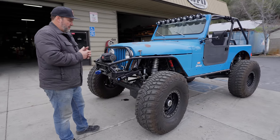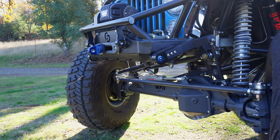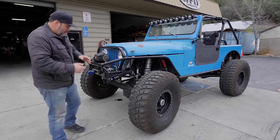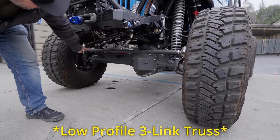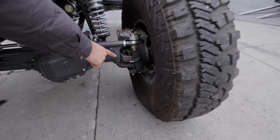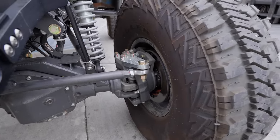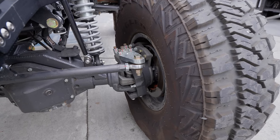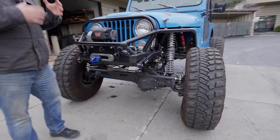It started with David saying, 'Build me a front and rear axle.' He gathered the engine, transmission, and transfer case and took all the parts to Clay. In the front we use the 1980 through '91 kingpin Ford Dana 60 with our low-pinion three-link truss. We added Crane knuckles on the outers, high steer arms, and upgraded the Ford brakes to '99 to 2010 GM HD dual-piston calipers. It still runs a steering box with hydro assist.